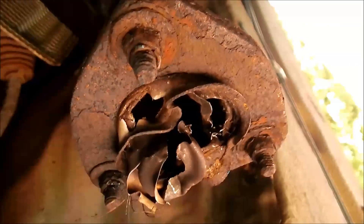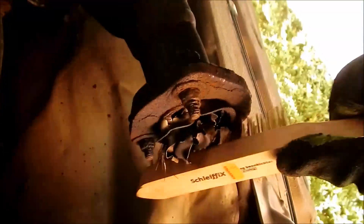Next, I clean the three bolts on the catalyst to remove the connector from the flex tube. It is of course possible to cut through the three rusted bolts with an angle grinder, but this must be done very carefully since the fuel lines are only 20 centimeters away. Now I spray the rust remover on the three bolts and let it act for about 15 minutes.